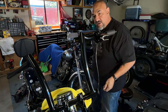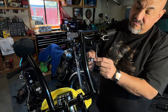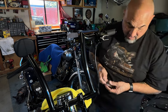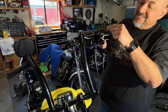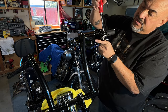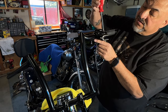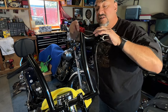Let's get the shell on there really quick. I'm going to see if I can find him some black ones, but I want to deliver the bike to him this coming week - this is what I have right now. It'll work to hold that, but it's got two holes in it. I think it'll look okay with the chrome and the black - it's got chrome and black all over, so it'll just have accents. Usually the grip sits inside of here, but these grips are different. I just want to get these screws started on here because I don't want anything to fall. There's another screw down here in the front. Just tighten it up a little bit.